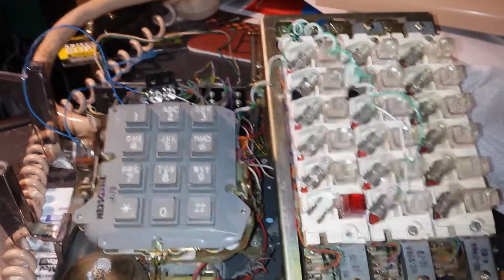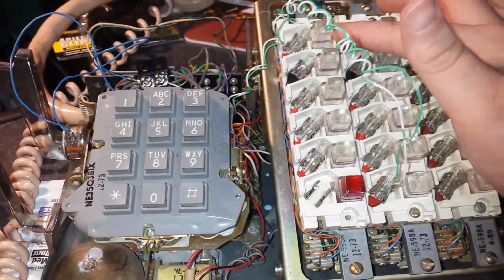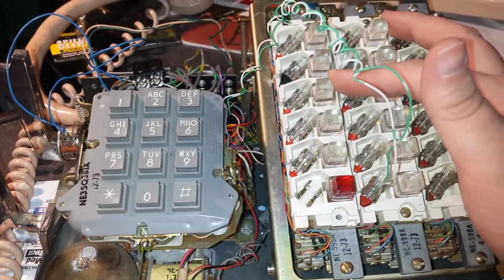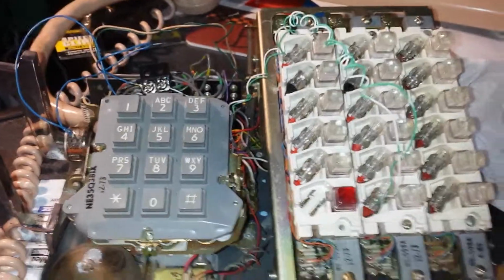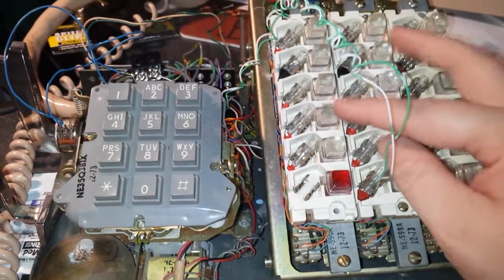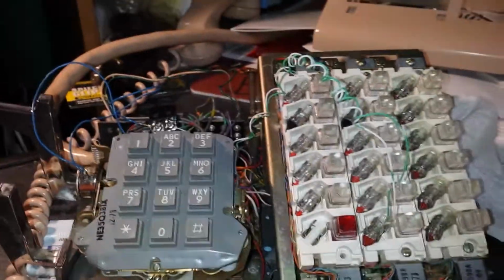For those who don't know, I do have this set behind a Merlin Magix phone system. So essentially, line 1 goes to a voice over IP line 1, voice over IP line 2, then my cell phone, which is connected through an XLink Bluetooth adapter. So when you press these lines, you get an outside line. However, this is extension 31, 32, 33, and this is extension 34. When you hit this button, it gets the Merlin Magix intercom line, and this is the internal intercom line. So essentially, I have these two phone systems tied together.